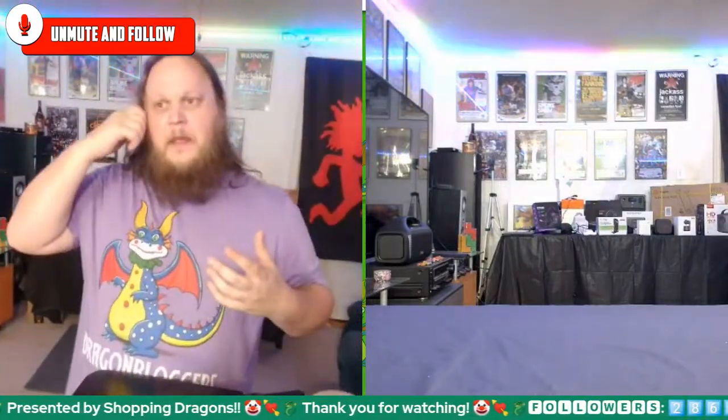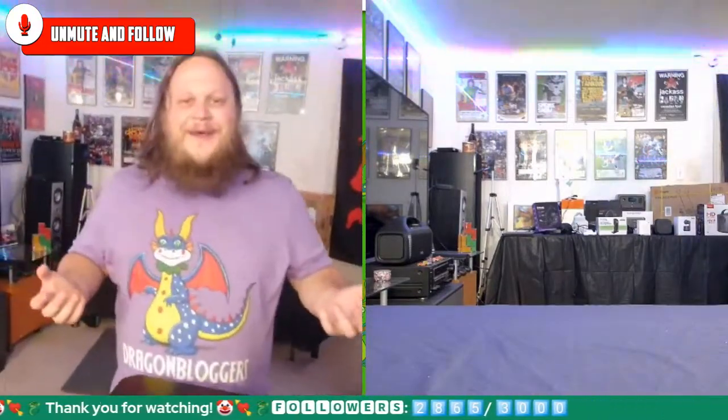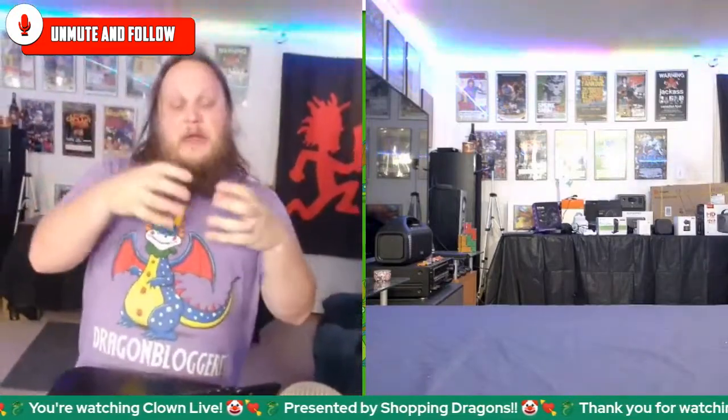In case you didn't know about this, because I didn't know about this for a while until I figured it out on my own, okay? And that's this. Clean the filter. I was using mine and it kept shutting down on me and I didn't understand why. It was because even though I was dumping out the dustbin regularly, I never cleaned between the metal shroud and the paper filter.